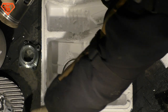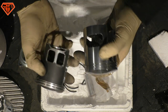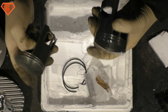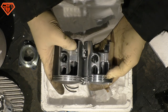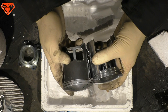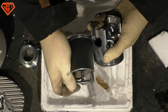Now, just to compare the Polini with the Malossi Sport. Malossi Sport is using VERTEX now. It was also an ASSO. ASSO in general, of course, is not bad, but it's just this standard piston that Pinasco and Polini use. That's just a fail, complete fail. So I did adjust it a little bit. And what I don't like at a sport piston is this small beam here. So I'm gonna cut it out completely. It's too thin.